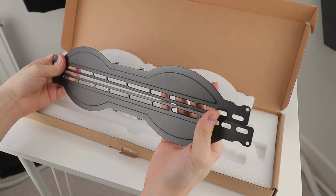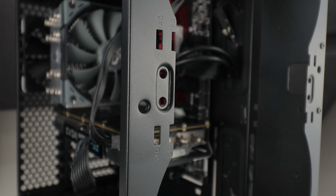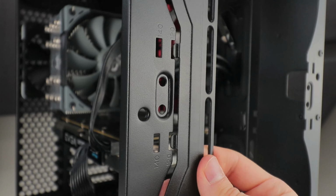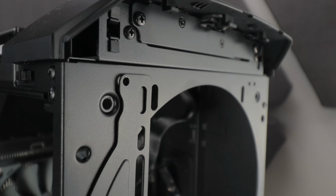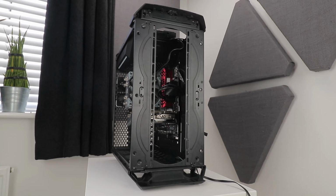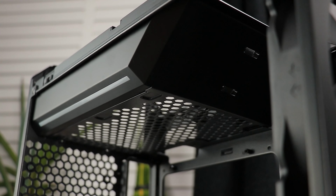Anyway, outside of the two 180mm fan support up front, we also have some brackets mentioned earlier, which allow the fitting for up to 3 120 or 2 140mm fans and accompanying radiators. This is taking too long as it is, so they exist for that purpose if you need it. There's no fan support up top, just an ARGB lighting strip behind a diffused strip.